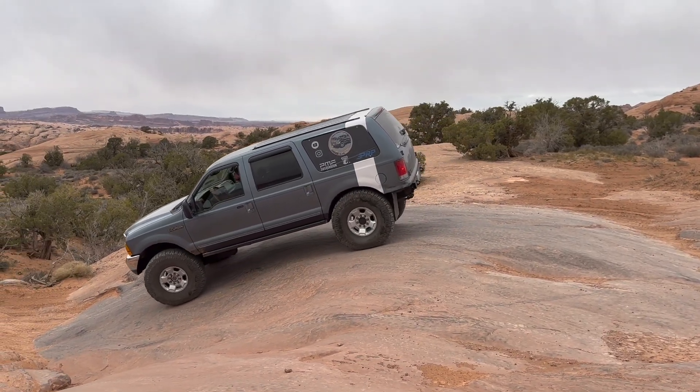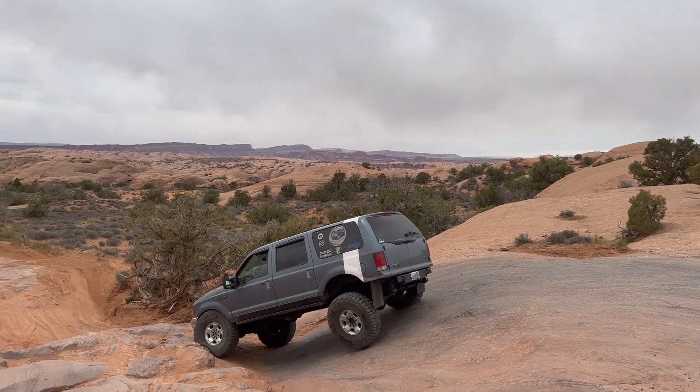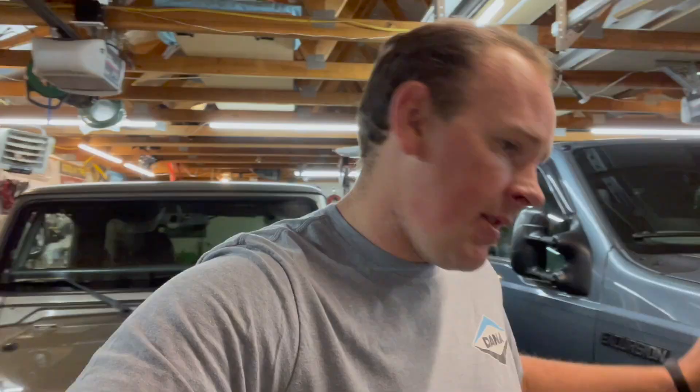Let's start in the front, because that's the main reason. The front is coil sprung, and the biggest deal for having coils on an off-road rig is getting more down travel. We get tons of flex out of coils, and we don't get as much down travel flex out of leaf springs. I can tag a video clip showing it picking the rear up, and the hope is that the front will stay on the ground. The biggest deal is the suspension difference - coil springs.